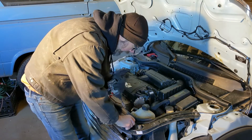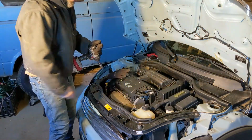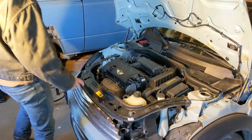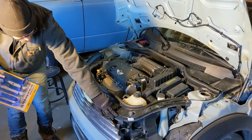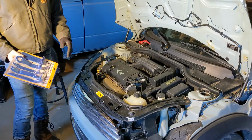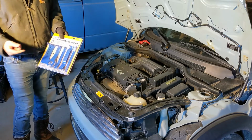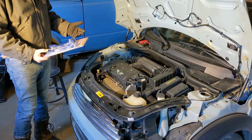Okay, next step is to remove the hood latches with a T30. There's 2 hood latches here. Those will go in a bag. All right, so the next step is going to be to pull these 4 plastic trim clips off the front. These make me nervous because I know they can break, as well as the grill. So I got my little trim and molding tool set, which I had to go get a knife to get into because it's in itself a challenge to get into.